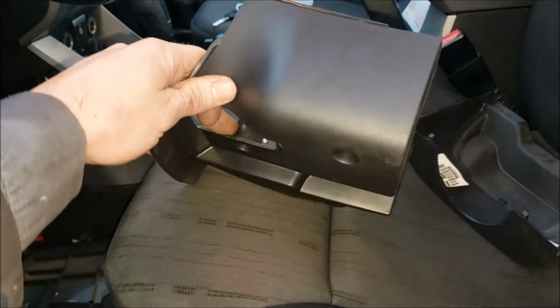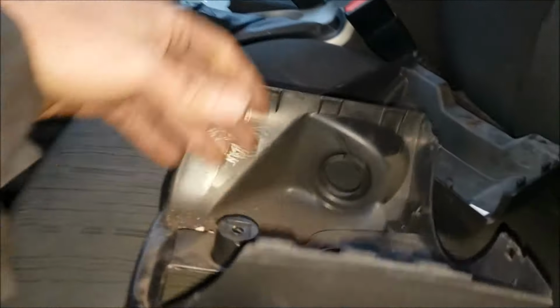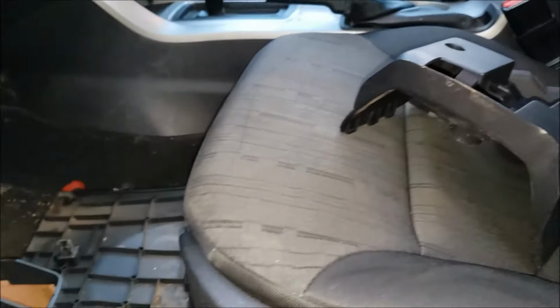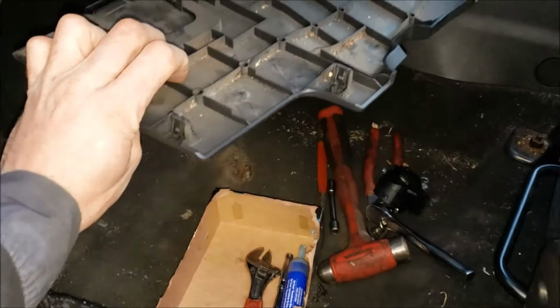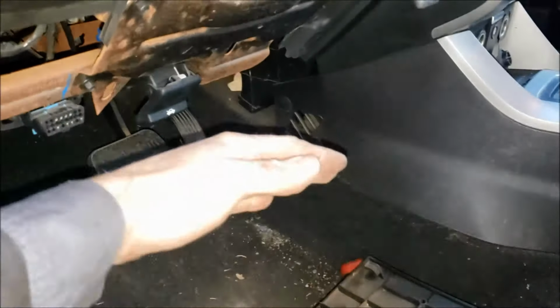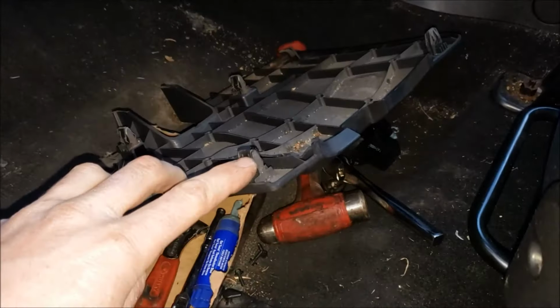And now you can just button it up by putting this lower steering column cover on, snap the top on, and secure those 3 5.5 millimeter bolts, and then snap this down here into place by hooking it on these first, and then folding it up so these clips snap in.